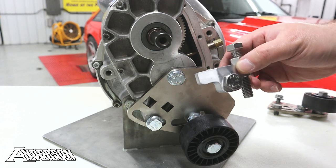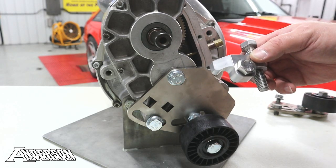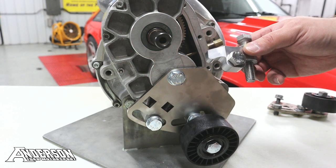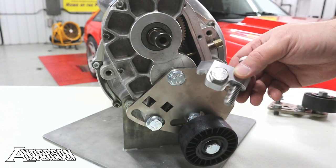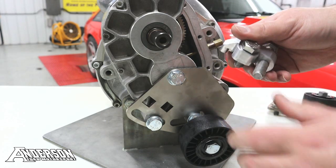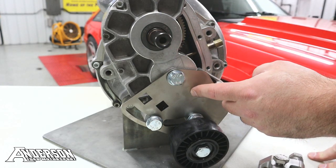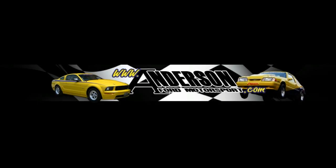So it's a nice little piece. I highly recommend it, especially if you're experiencing issues where you can't get the supercharger belt tight enough using your own leverage and strength. This will give you the mechanical advantage you need, using the bolt and jam nut to do it for you. Just remember to modify the newer brackets so you can use the bolt.